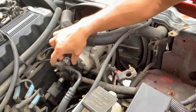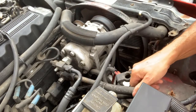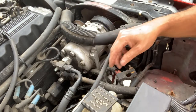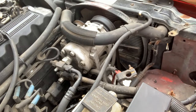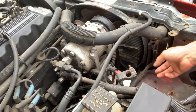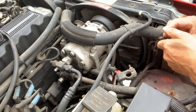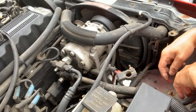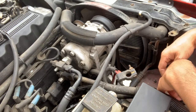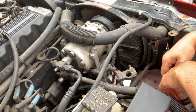Since there's no gas pressure, I changed my mind — it's safe to loosen all the fittings and check the other components. All I have is the new compressor, new condenser, dryer, and the block valve. I don't have the tubing yet. I have to inspect components — for example, one tubing is really badly rusted and probably needs replacement. I'm going to take all the components out, inspect them, arrange what additional parts I need, and then put it back together.